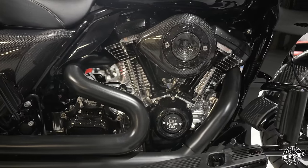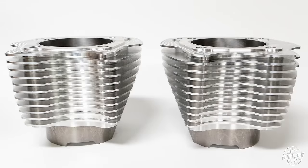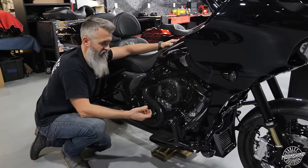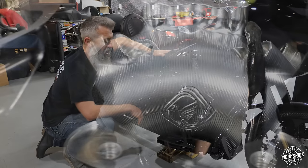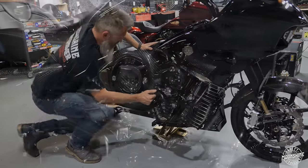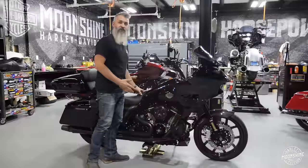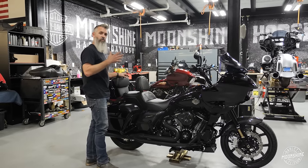143 cubic inches and full show polish. These cylinders — to get like this, we start them off with our MHP CNC Game Changer cylinders and then have them polished. The heads on this engine are a pair of our Moonshine Horsepower Monster heads. They have titanium intake valves, Inconel exhaust valves, and they are 2.5 millimeters over the stock size valves that come in one of these M8 engines. It has our MHP Monster intake manifold made for a 70mm throttle body, running the Horsepower Incorporated 70. We polished everything — the intake manifold in there is show-polished. You don't see a lot of bikes done like this anymore. Anytime we can do a full polished engine and transmission, we are going to push for it because they look so nice.